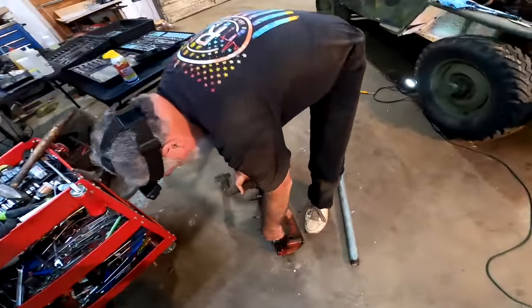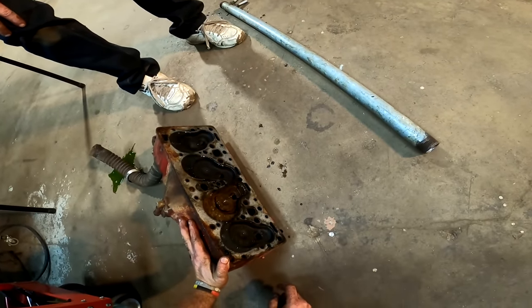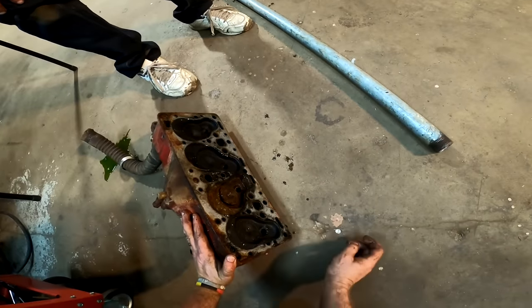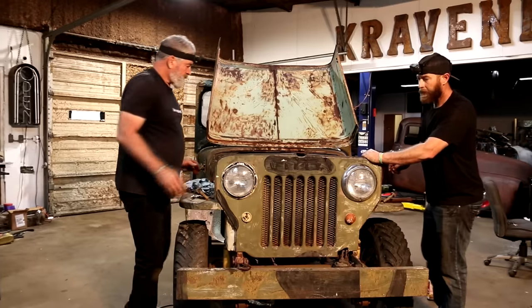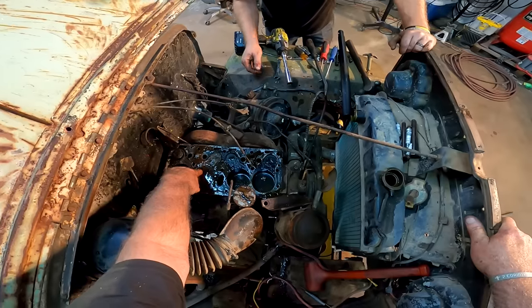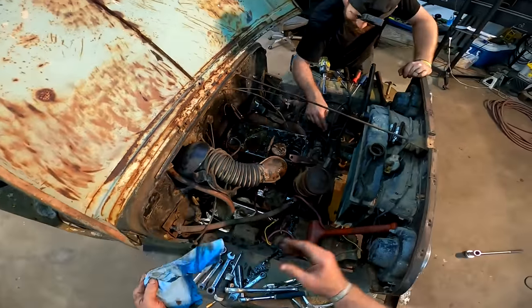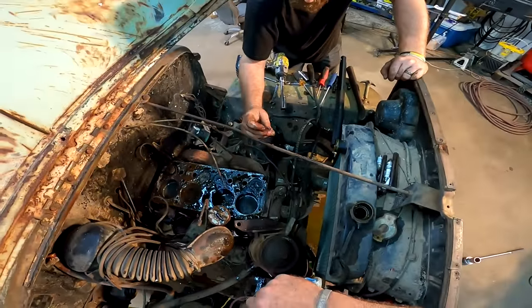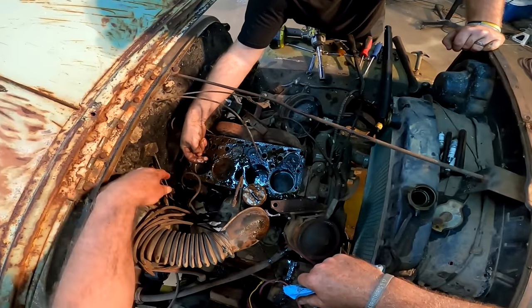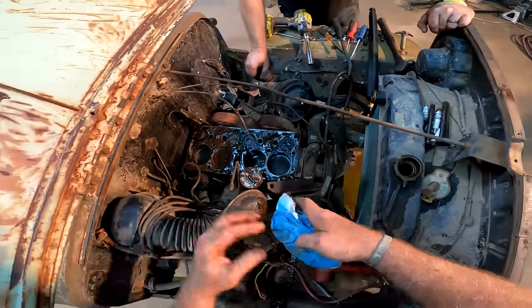What does the bottom of the head look like? Ugh. That one right there. That valve there, I don't know. Pretty rough, ain't it? Stuck open. Huh, that's gonna be our main problem, I bet you. Wait, the third one, this one here? Yeah. Yeah. That looks pretty nasty. It is nasty. Like you say, it's kind of oily. Yeah. Ugh. There's no telling, because that one's wide open.